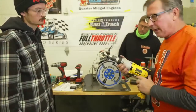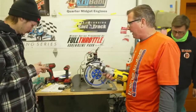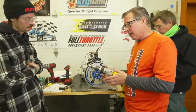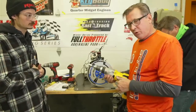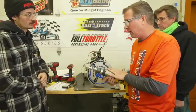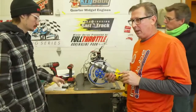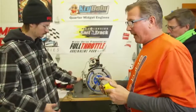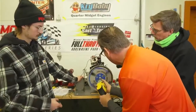So I don't understand. The drill goes to 1,200 RPM. Why can't we just check the timing at 1,200 RPM? You only need 1 RPM. But they say 1,200 to 2,000. Well, that's a lot of gray area putting that 2,000 in there because it's hard to hold the drill at 2,000. And most any electric drill that you find will not be full trigger 2,000. This one's 1,200 and I don't know, we'd have to spin it again to know the max on the other speed. So again, why not write the rule 1200 RPM and pick your degree of timing if you want a 20 or 20 and a half. But this monkey business of going to half degrees and 2000 RPM, that's just to muddy the waters, but this engine's clearly out, so we're not debating that.